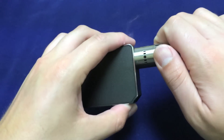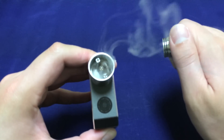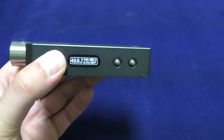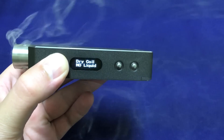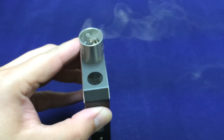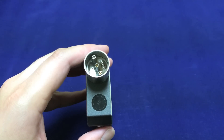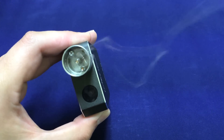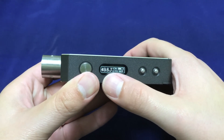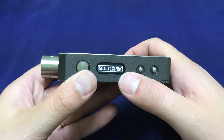Now it's set at 350 degrees. The cotton is fairly dry, and you'll see that it's not giving us much vapor. When it senses that the temperature is rising too quickly, we'll get this warning message — 'dry coil, no liquid' — and it just about refuses to burn that cotton. I've been using this for a while so my coils are getting a little build up, and I may have a hot spot in the center, but no burning cotton. The temperature limiting function does work. You'll notice that setting is 49.6 joules. If I cycle through my presets again, they are back to the factory setting — so those presets are non-adjustable.